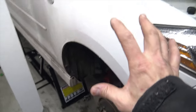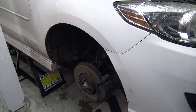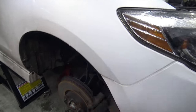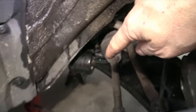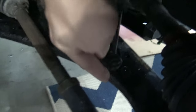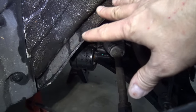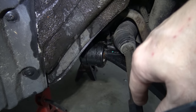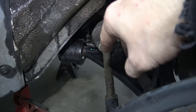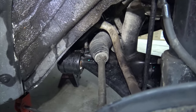The main problem is the suspension on this vehicle is starting to go. It was making clunking noises going over bumps, getting progressively worse, so I replaced the lower control arms — you may be able to notice they're brand new. That got rid of some of the noise but by no means all of it, so there's still a problem. I've traced it down tentatively to the inner tie rods. I know they don't seem to go very often, but that seems to be where the clunk is.